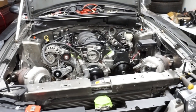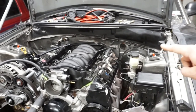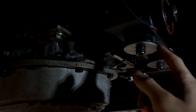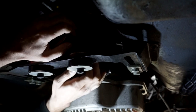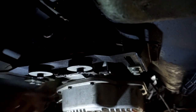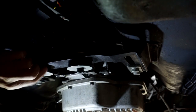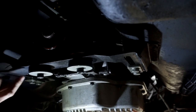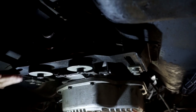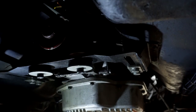By the end of this weekend I'd like to get the car ready to wire. I'm also pulling the engine and transmission back out. There's something I want to rework on the back side of the transmission mount — even with the bolts fully tight, I can move the transmission back and forth by hand. I actually noticed it by accident when I bumped the crossmember and the whole thing twisted.